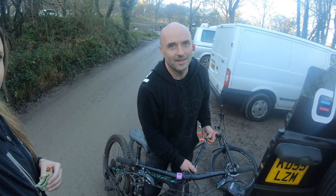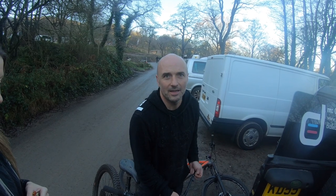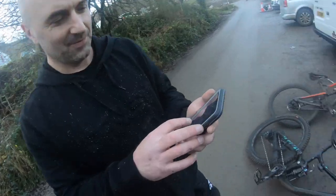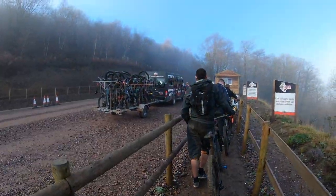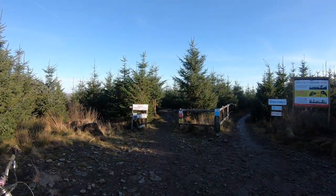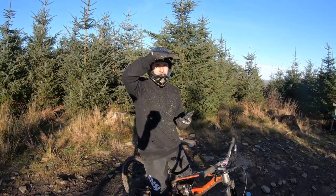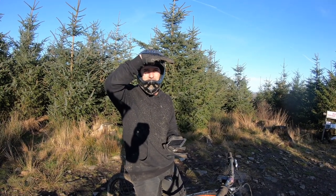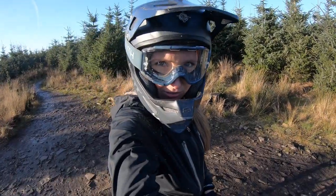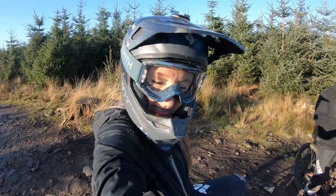What we notice on Alyssa's bike is it's not really using all of the travel on the fork, which usually suggests we could take a volume spacer out to reduce the ramp, but there's none in there. This is quite often the problem when you've got a very light rider, because ideally we'd want to increase the volume but we haven't got the option. Checking the data through, we've put a tiny bit more rebound damping in. We've got three clicks more rebound damping on the fork and an extra few PSI in it. So we'll see how it feels.